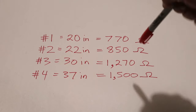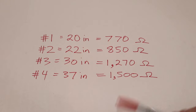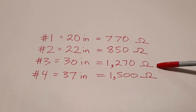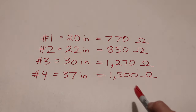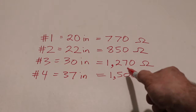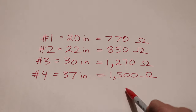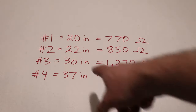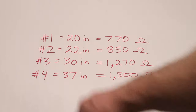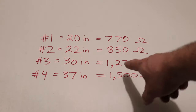When the whole set needs to be changed out, it should be changed together. The lower resistances also tell us these are likely aftermarket spiral core wires. Spiral core wires should have roughly 300 to 400 ohms up to about 3,000 ohms per foot. Taking the nearly two-foot wire and doubling those numbers, we're within that range at 850 ohms, and each wire's resistance matches its length — confirming this is a good, healthy set.